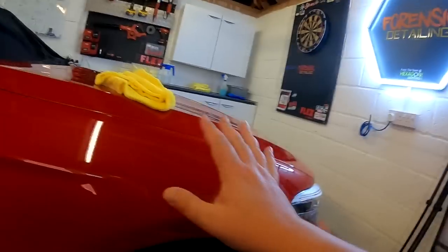It's asking quite a lot of the product, but the standard of where this panel is now after that simple polishing set is a standard where I am more than happy with it. What I will be doing is probably a final polish with a glaze type product, maybe the Bilt-Hamber cleanser polish, and then a wax will go on top. So it will get one very, very quick covering of like a glaze and then the wax as well, which would literally take me like 30 seconds just to cover that panel again. And then that'll be fine.